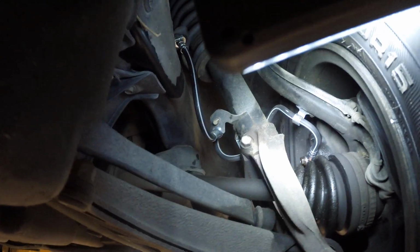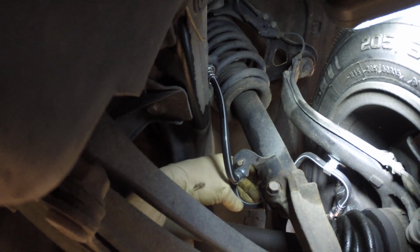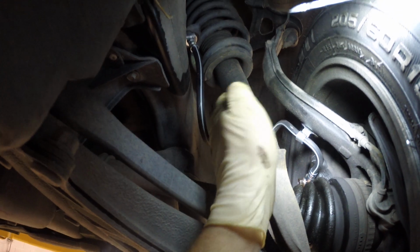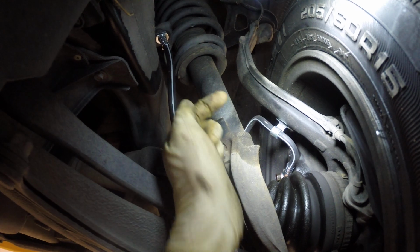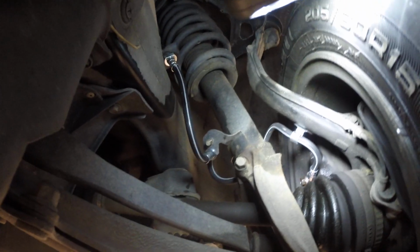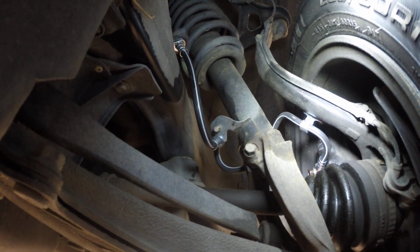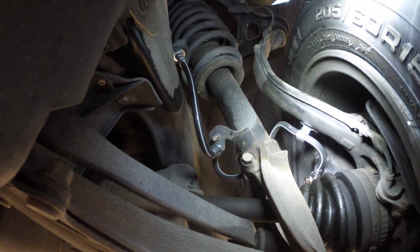If we go over here and look at the other wheel, see where our brackets are? This bracket here and that other bracket around there. Imagine this strut assembly rotated around in this direction. It would take this line and put it right over here, so that when this wheel turns to the right, it would rub right there. So there is no conspiracy. This person does not have any secret enemies that secretly cut their brake line. They just had some struts poorly installed.